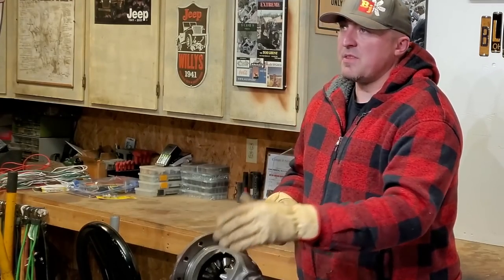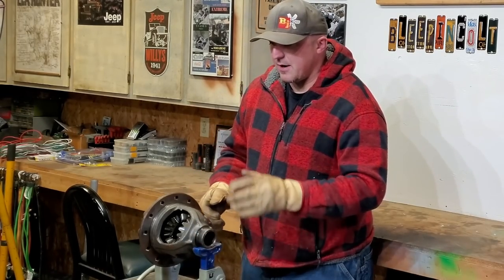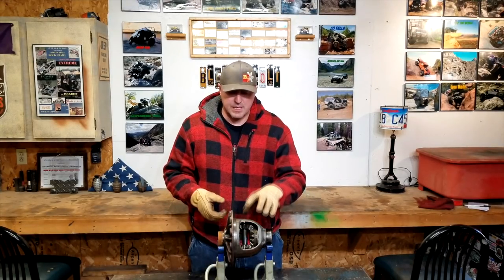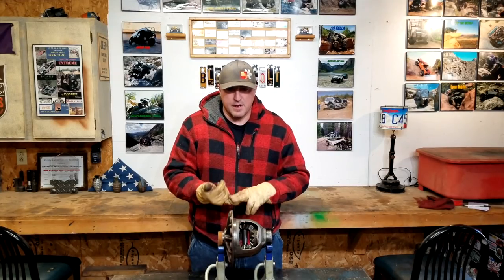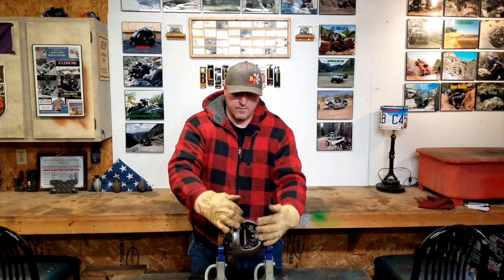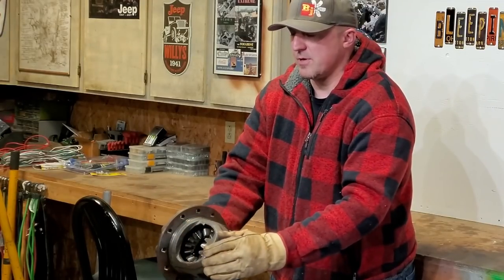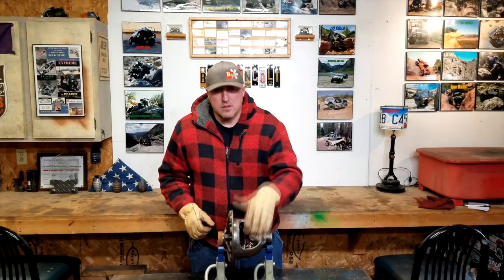That's great for off-roading, great for solid straightforward traction, not so great if you're driving regularly to the mall. This is something that's super cheap and super awesome to do. I chose to do this because this is a Dana 60 carrier — super common. This Dana is the same as what you would see inside a Dana 27, Dana 30, Dana 35, Dana 44, Dana 60, 8.8, Dana 70, Dana 80 — any of those axles. If they have an open differential, you open up that carrier and this is exactly what it's going to look like inside.